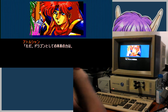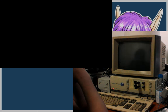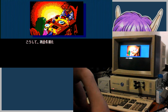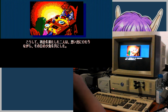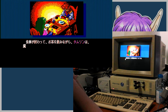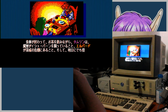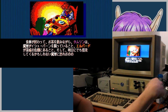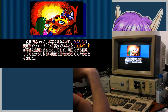I do highly recommend getting a CRT if you can afford to. It makes a lot of difference. But an OSSC will do the trick for you if you want to use an LCD with it. And some LCDs will even just work with 24 kHz, but not all. And 24 kHz, by the way, I'm referring to the horizontal scan rate for the 400 line mode.